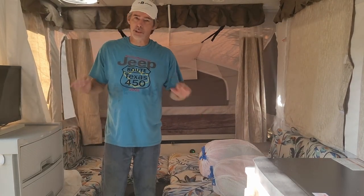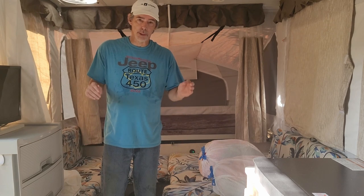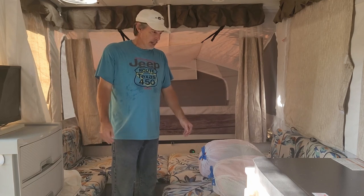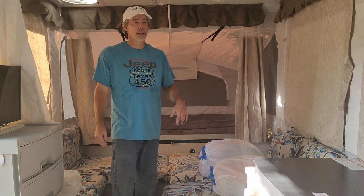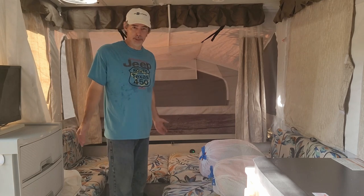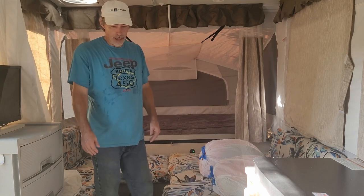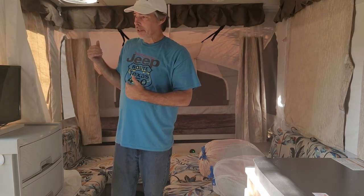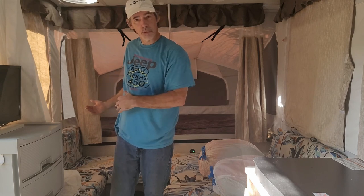So that's what this video is about — just putting these shepherd's hooks in one-handed. Very easy. Just don't pull the bunks out all the way. I promise you it works — I just showed you that it does. If you have any doubt, give it a try. Now I'm not sure about all models. This is a 2022 Rockwood 1910 ESP. But I would imagine most any pop-up, since they're all basically the same, if you're having problems getting your J-hooks in, give this a try, because it works. It also makes it easier putting the door in if you go ahead and set your door before pulling the bunks out. There's no tension stretching the canvas, so you can Velcro it up, just line your Velcro up where it's supposed to be, then go pull your bunk ends out and you're done.